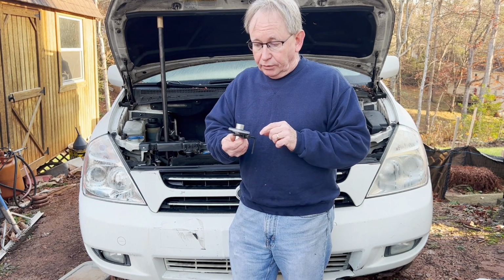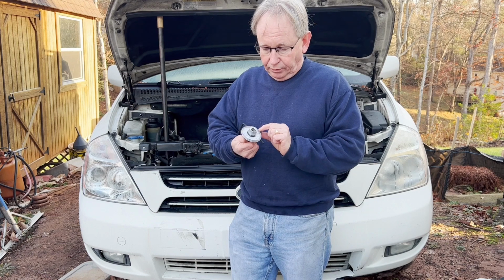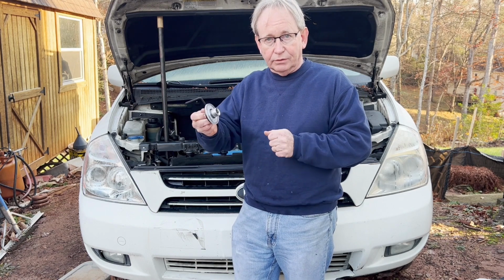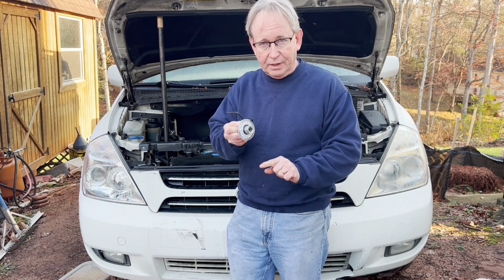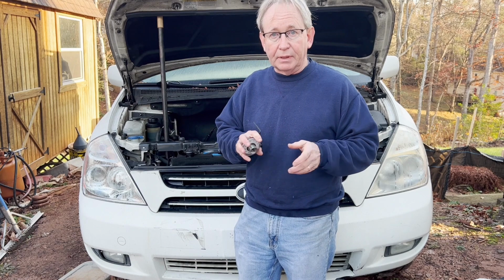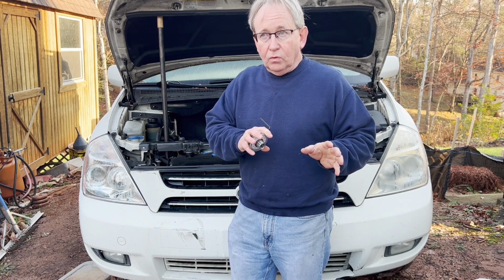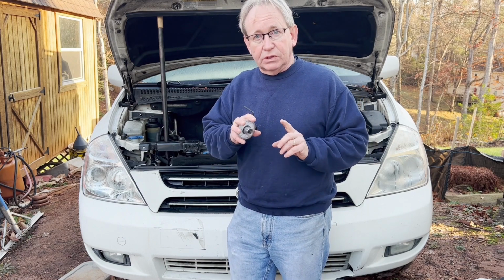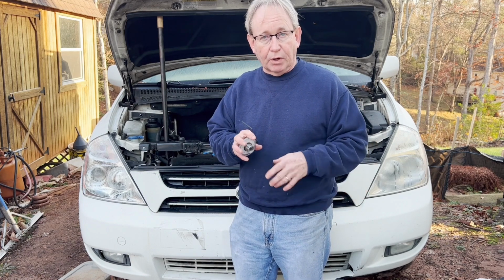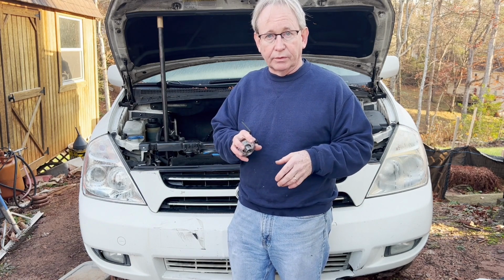When I go to do the 120-degree pull, I get, I don't know, 75, 80 degrees in there, and all of a sudden you'll see the thing go zip, and well, that's it. Damage is done. And it happened on 6 of the bolts. The 7th, I was able to get a torque. It went as it was supposed to. I was able to pull 120 degrees on it.